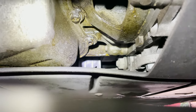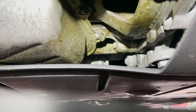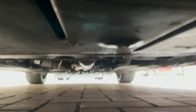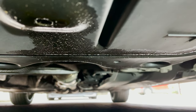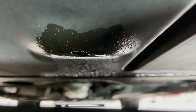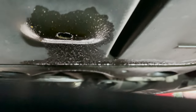So it looks like around the sump casing there is oil residue coming off. And if we go further back, it's dripping off the undertray. It's at the back of the undertray, front of the sump. Which is why they need re-sealing. Because the sump's to the left, so this is more to the right. But there is a big, like, drip hole.